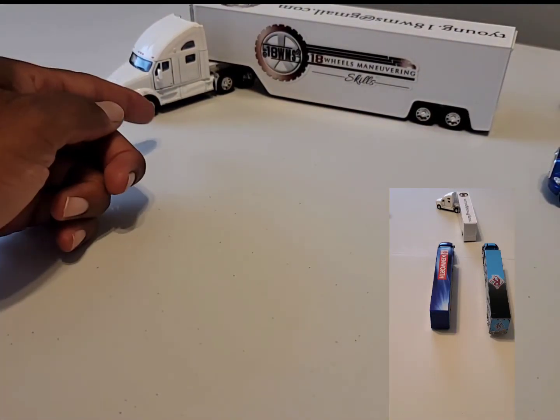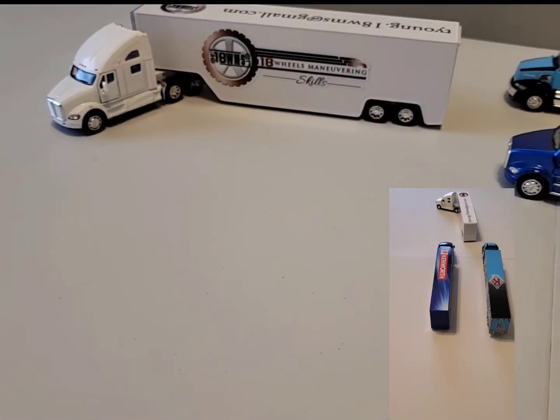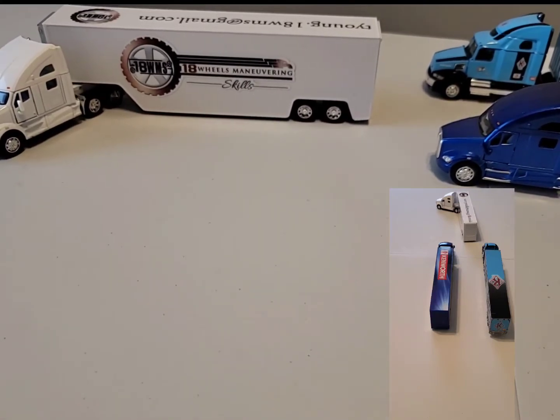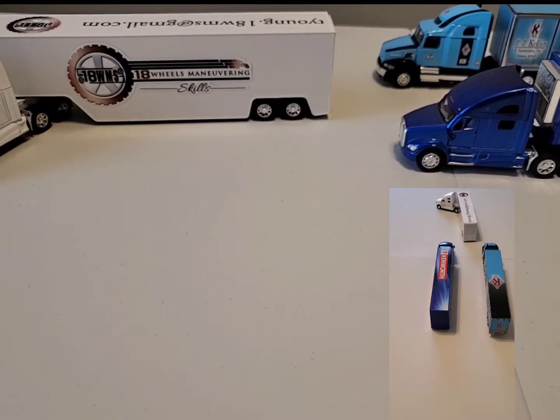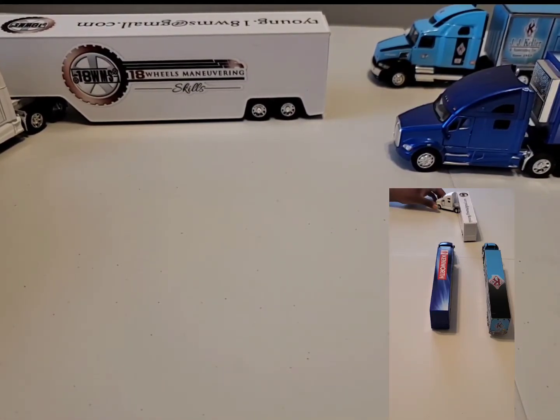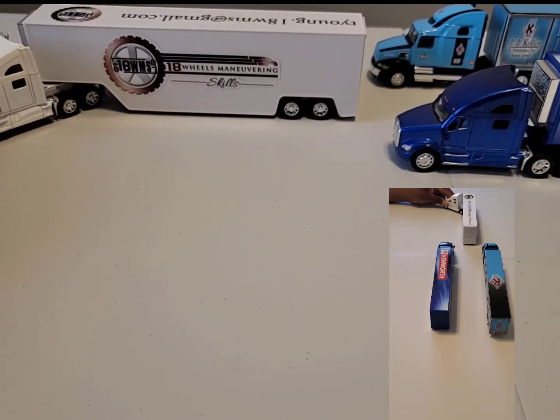You have to keep it to the left, because if you turn it to the right to put the jack in the trailer, guess what is going to take the jack out of the trailer? It's that left. So trust the left. Okay, so you keep it to the left and keep going back, keep going back. It's looking good.